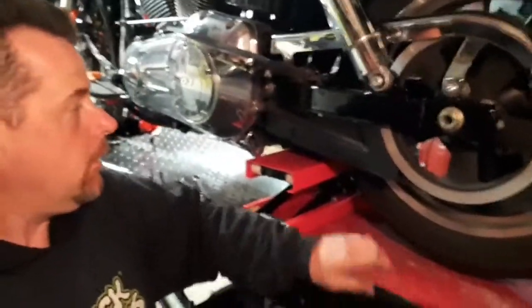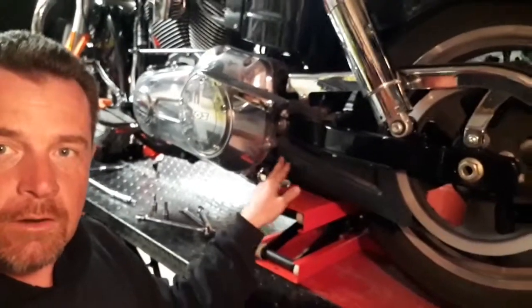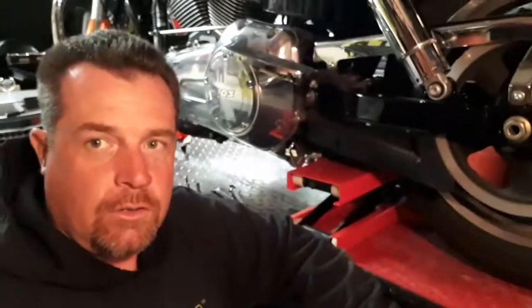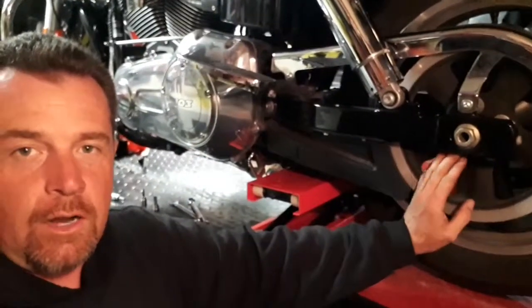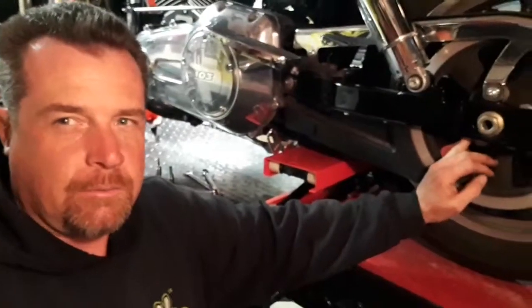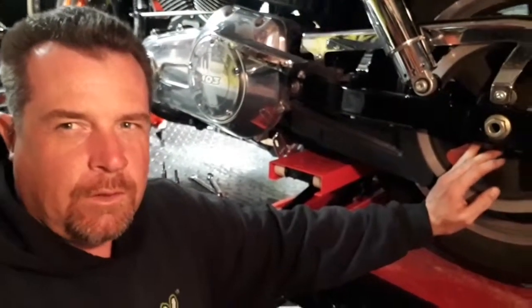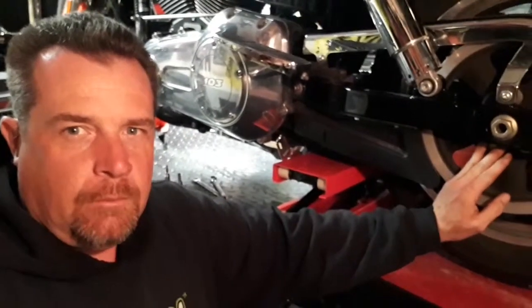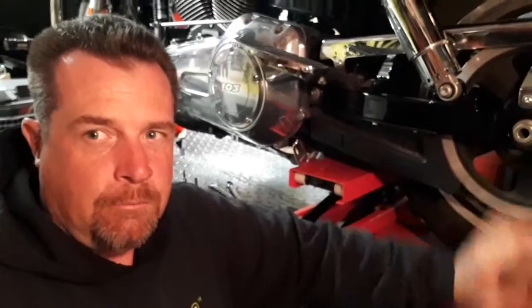Check on your drive belt back here. Harley's nice enough to show you your tolerances right there — you have a gauge to check your allowances. Go through and check it with a 5/8 wrench and check all your drive sprocket bolts, because apparently on the Dyna that's something common that can back off. Just make sure they're snug — you don't want to reef on them or strip them, because then you're into a whole mess with your hub being stripped.